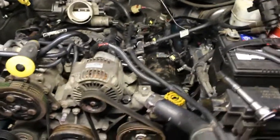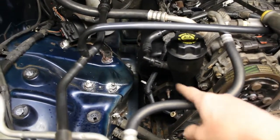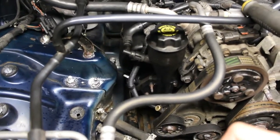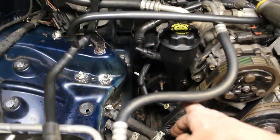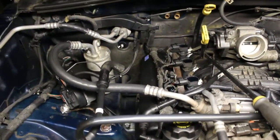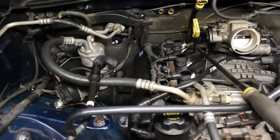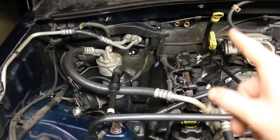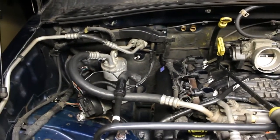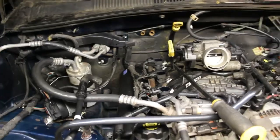So it's moving along here. I don't know if I mentioned it before, but I did hook up the oil filler. It's got four bolts, and the top left one is longer, because the coolant lines get mounted to that. The last bolt towards the rear, towards the firewall, is also a long one that the coolant lines mount to on that side. There are two plastic mount pieces that go over that long shaft to hold it in place. So it's coming along.